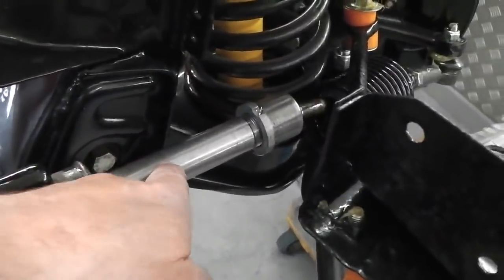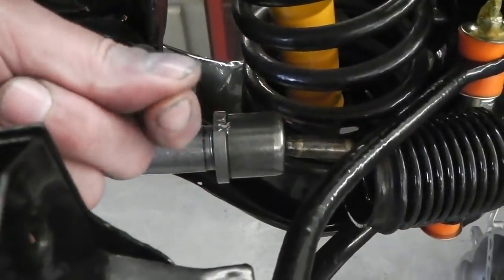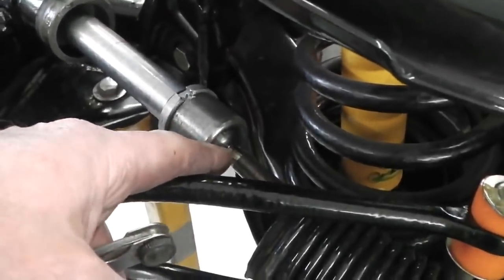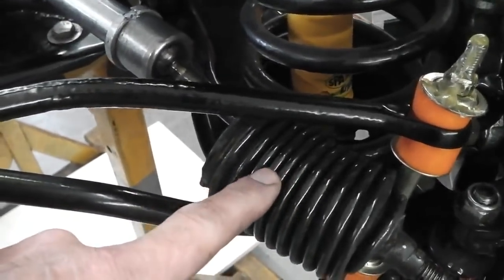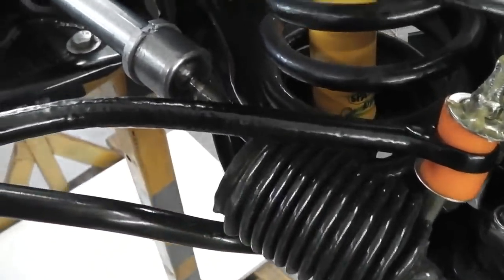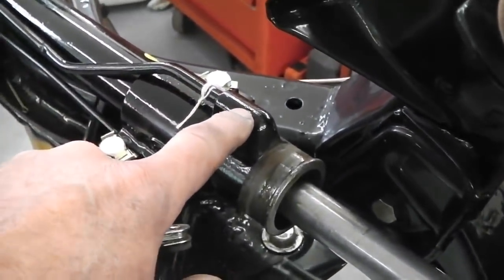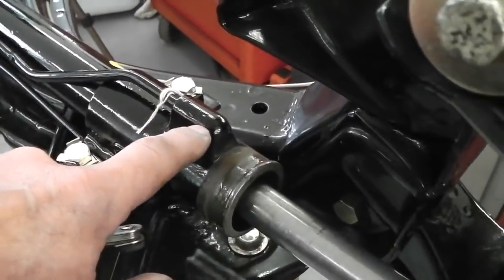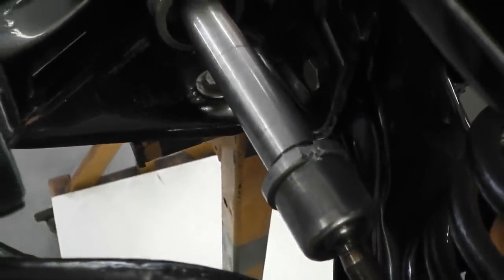Curious as to why it would be so dry. Very clean, but as I said, some light engineering oil on it there, but I don't think that's sufficient lubrication. I will go for lithium grease, not a lot of it, because if you pump too much in, it's just going to find its way out or mess about in there. And you've got these pressure release tubes or equilibrium tubes, and you don't want to gunk everything up with too much grease. So not going to go crazy there, but both ends need doing.